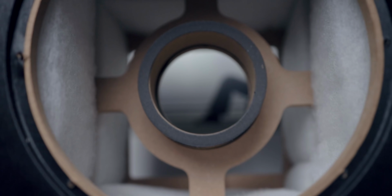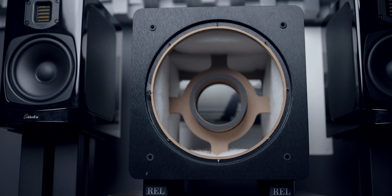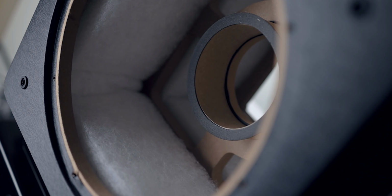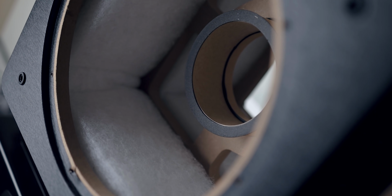And for most subwoofers, it makes sense that the cabinet should be about twice the weight of the woofer itself. It's not a straight up rule, but it's good to have that kind of basis. And also the cabinet inside has really nice bracing, like really hefty bracing. And the cabinet is 1-inch thick MDF material, which is nothing special, but again, it has really good bracing and everything is well designed for $440. It is done well in every aspect. I would say that no corners were really cut with this subwoofer given the budget.